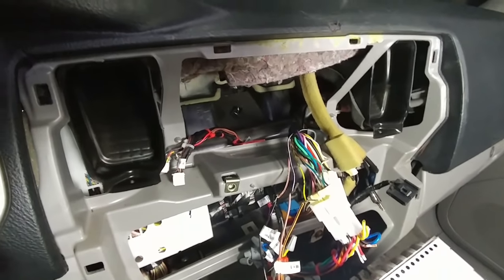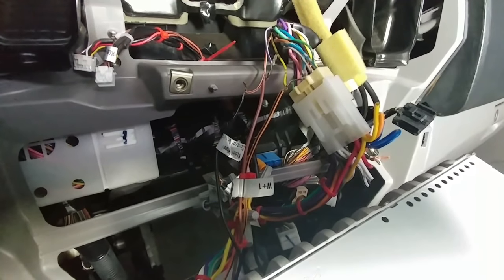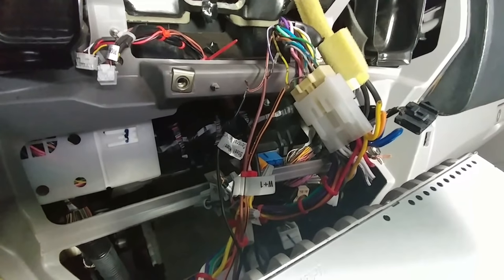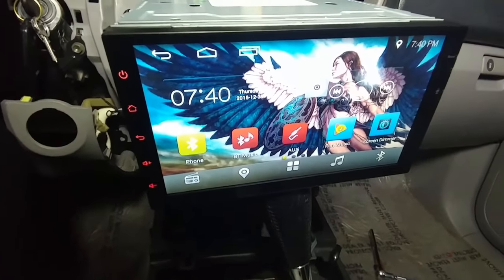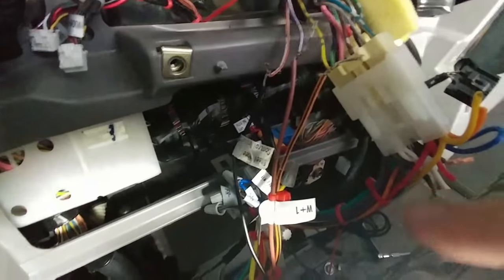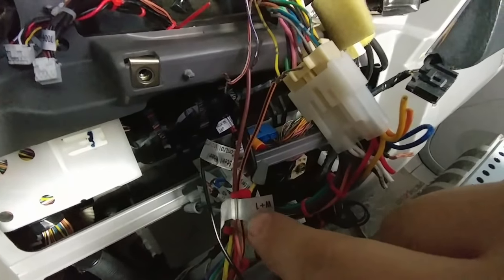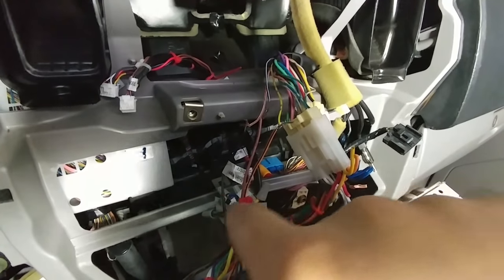I knew I could do it, I just couldn't figure out how. Here are some key terms you're going to hear a lot: Key 1, Key 2, SW1, SW2, SWC1, SWC2. If you have this one that I have — the 6.0 Android — it's probably labeled W+1 and W+2, which is what this one says. These two are Key 1 and Key 2. I thought they were Wi-Fi antennas or something. Everything I found on the internet says Key 1, Key 2, or something along those lines. These are what you're looking for with this Pumpkin head unit — W+1 and W+2.